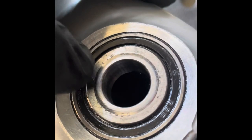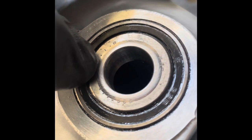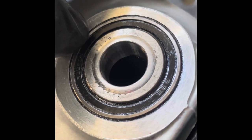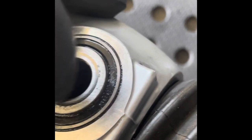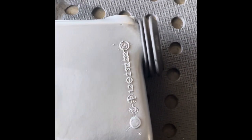It's all clean — no grit or dirt in there. It was all cleaned with brake cleaner until dry, then I spun them — still nice and quiet after 80,000 kilometers. I repacked them with grease and press-fitted that seal back in on both ends. No irregularities, no grinding — smooth as silk. They need to be done too.